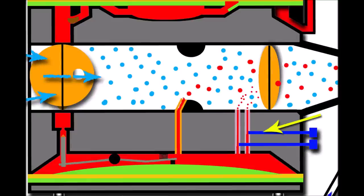The bulk of the fuel is provided by the main jet, while the mixture screw fuel holes provide a smaller amount for a precision ratio. The amount of fuel coming out of these little fuel holes has to be adjustable — that's where the fuel adjustment screws come in. The end of the screw protrudes out into the actual fuel vein. Screwing the adjuster screw in further chokes off that fuel — less comes out. Screwing outward means less restriction, allowing more fuel to be released.